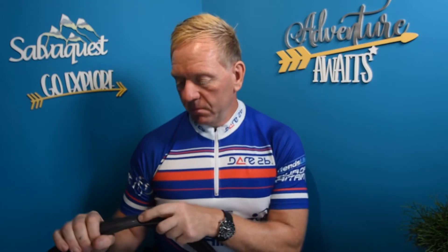One thing to remember on these tyres, as with most tyres, they are directional. There is an arrow — it is a very, very tiny arrow on the wall. Make sure that you have it in the right direction. It is very, very difficult to see, sometimes a little bit more visual, but it's there. Make sure you have it in the right direction.